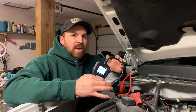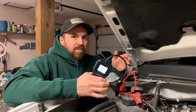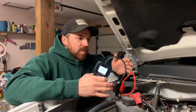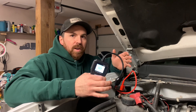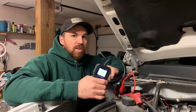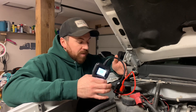As far as diagnosing goes, you can't only go off your battery tester. If a car or truck comes in with a dead battery and they say they need a battery replaced, and you test it and it tests bad — still try to charge it up, start the car, make sure your alternator's charging, and make sure you don't have a bad cable somewhere. Nine times out of ten you probably do have a junk battery, but you should still double check because things happen. I've found some goofy issues where it seemed like a dead battery, or you may have a battery draw — check for a draw.